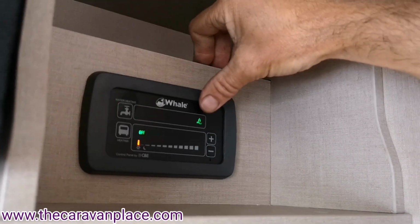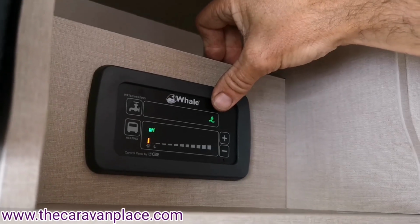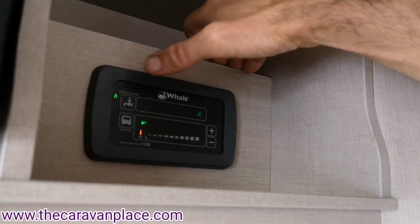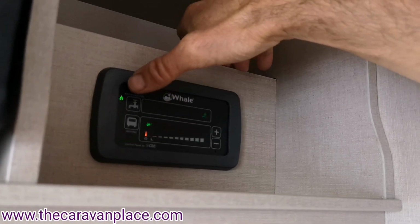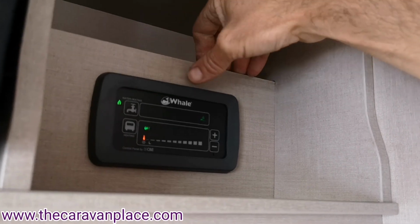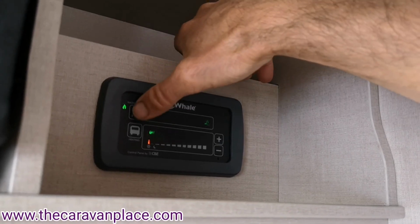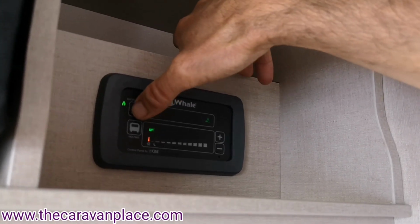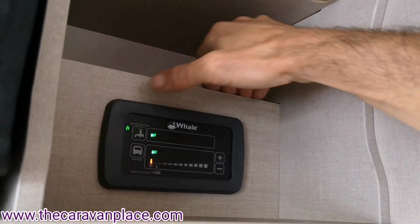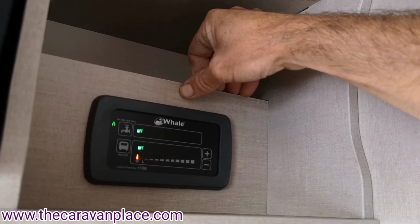And again, if you want it really quick, you should have hot water within about 15-20 minutes by running it on the highest setting, which is gas and electric. And then we've also got to say that the boiler's working on the gas, the other little indicator just here, and that's lit up just to say that that's actually running on the gas system. To turn that back off, just go all the way through, click it back and then into the off position, and then we'll see the gas indicator turn off in a second.